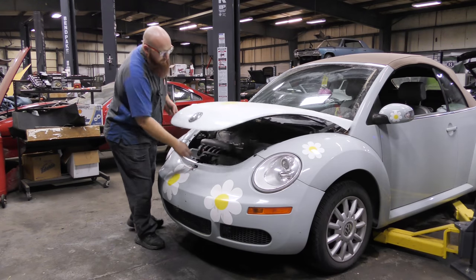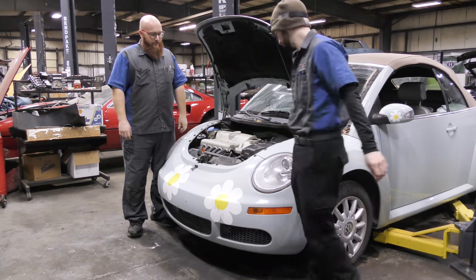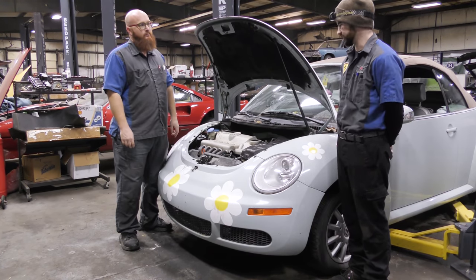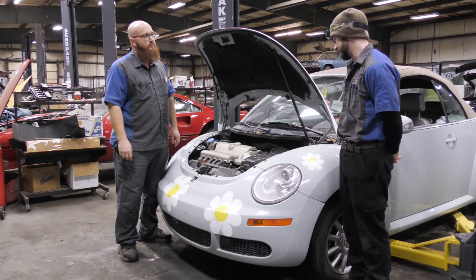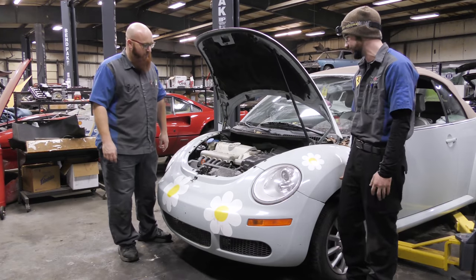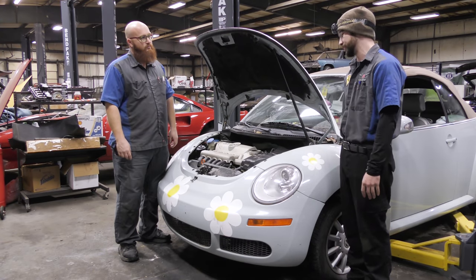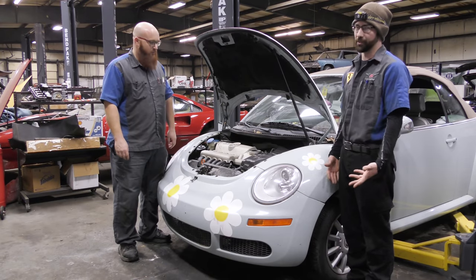We'll go ahead and get this bonnet opened up. Magic Mike diagnosed these problems. It came in with a check engine light and a major oil leak. When I scanned the codes, I found four different fault codes. Two were for a mass airflow sensor and an intake air temperature sensor fault — the cable had been completely disconnected and was dangling by the brake fluid reservoir. Once I got that reinstalled, those two codes went away. The other two codes were for an intake manifold air pressure sensor and the EVAP leak detection pump, both open circuit faults.